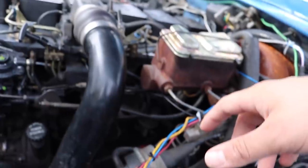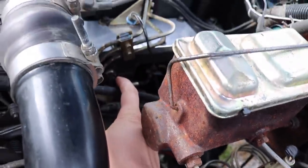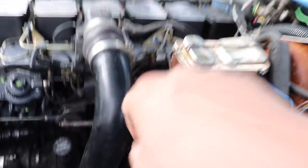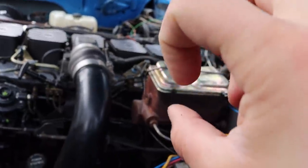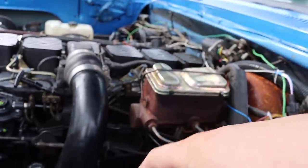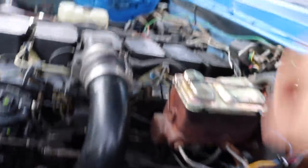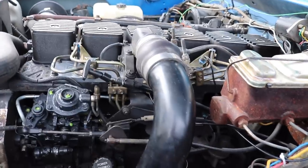It's a little digital one, so it's not actually like a fuel line pressure line running to the back of the gauge, which is kind of an old school thing. It'll be taking out one of those banjo bolts and replacing it with basically another one that has threading on the back side, so I can thread in the fuel pressure monitoring sensor into the back of it. That way we can plug this in and read our fuel pressure.